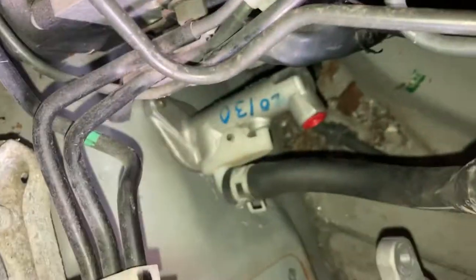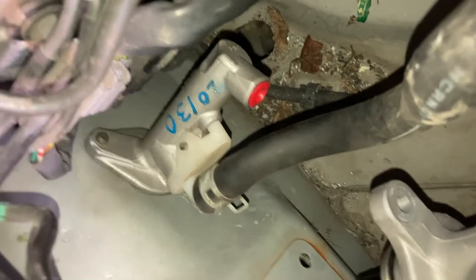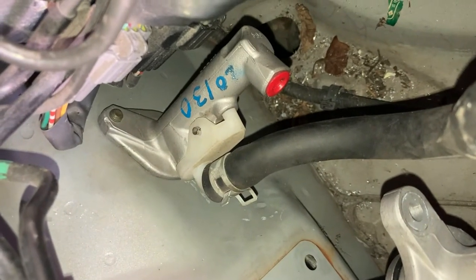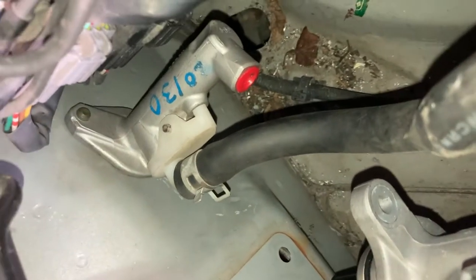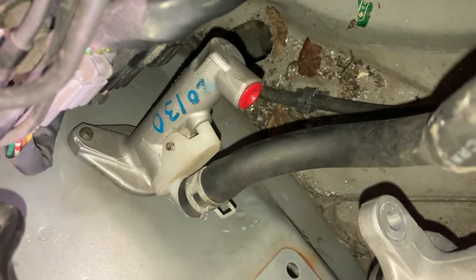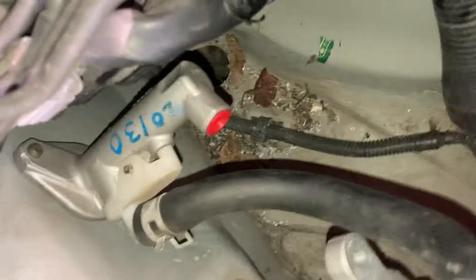There are the bolt holes they gave you, so that's how your reservoir is mounted. I think I'm over a little far, but I wanted to make sure I had the brake pedal in and I didn't want to be stepping on the brakes as I was pushing the clutch. I don't have little baby feet. I know these pedals can be pretty close together in a stock G — I've heard some guys complain. I gave myself a little extra room.